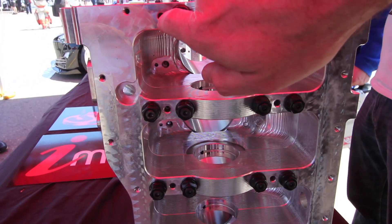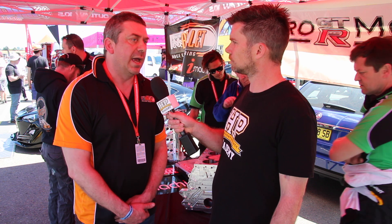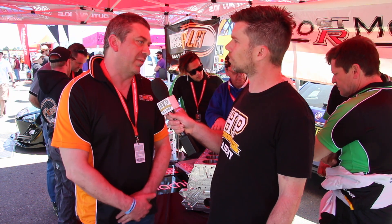The fretting isn't only movement — the cradle can actually separate a little bit too. Now when you've got such a solid bottom end with everything so tightly held together, that can be challenging for the engine builder to pull apart when it comes time to freshen up or assemble the engine. Above the dowels on the front and rear of each main journal, we have an M6 hole, and we supply a long M6 set screw which you can wind down on top of the dowel, allowing you to just lift the cradle off the dowels without needing a mallet. It also doesn't damage the block because you're winding down on top of the hardened steel dowel.